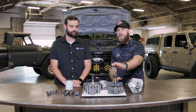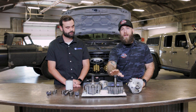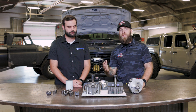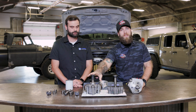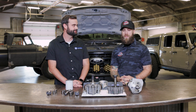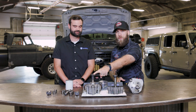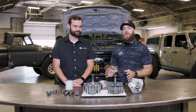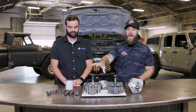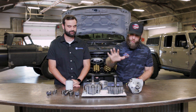There's something I wanted to touch on with the DCR conversion — we get a lot of comments about how much it costs. This is very inexpensive compared to when your CP4 grenades without a DPK and destroys your entire fuel system. We've seen quotes from $10,000 to $12,000 to replace the CP4 — and they're going to put another CP4 on it, which could also go bad again. Ten times out of ten this is always going to be the best bet. It's preventative, it's going to cost you less than when the CP4 goes bad. And if you're not looking to spend that much on the DCR upgrade yet, at least put a DPK on your CP4 so when it goes bad it catches all those metal shavings and doesn't destroy your entire fuel system — then when it goes bad you go to the DCR.